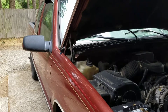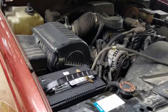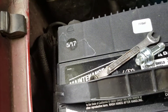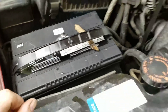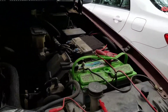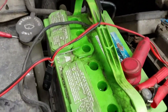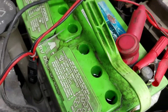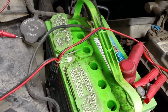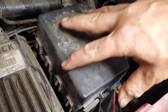She was having an issue when it was cold and didn't want to start — that sounds like battery. I came in here and looked: 5 of 17, she just replaced this battery. Looking around, she has another battery that's currently on the charger. Cells were all low, and I don't think there was anything in the positive side. I've got them filled up, vents off, and it's charging — very slowly, but it's charging.